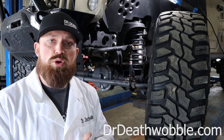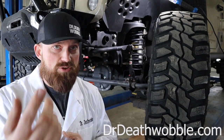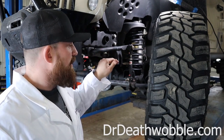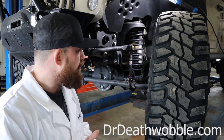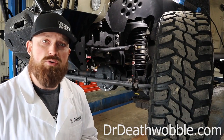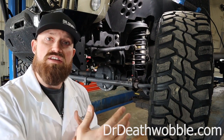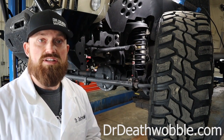That's all because of poor suspension design. These principles work on both the front and the rear. I want to see my sway bar either at least flat or maybe even a little raked upward if I have a ton of down travel. When looking at buying a new suspension system for your Jeep, that's one component you definitely want to look over in the kit. If it's not included, you're going to have to buy it additionally because it really needs to be addressed.